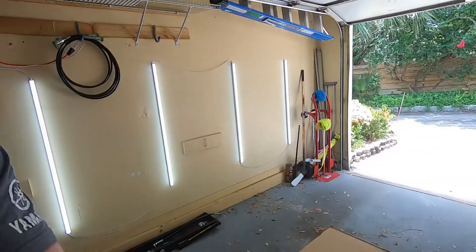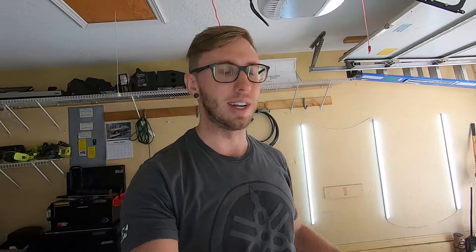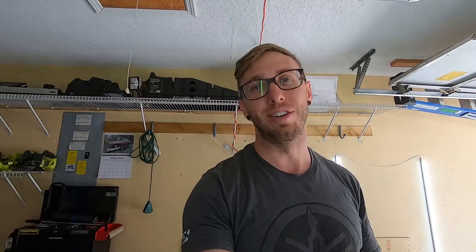I originally was going to just tape off the whole front grill and Plasti Dip that, but then I decided to pop the hood and see how easy it would be to pull the grill out. It was only about five or seven screws or bolts to undo under there, and some were actually missing and some were finger tight. So I'm going to remove the full grill, bring it in here, paint it — no taping required. Super easy doing it that way. If you have the option to remove your grill, I highly recommend it because taping is a pain and then you have all the peeling to do. With this, there's no peeling and no taping.